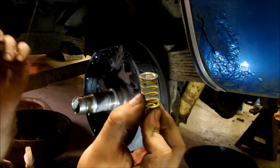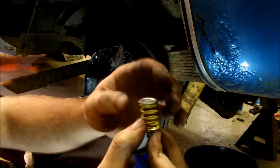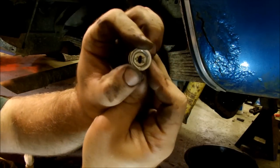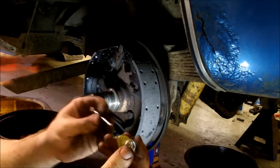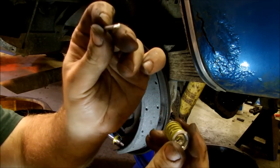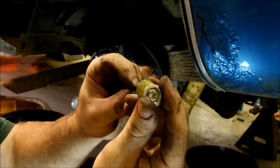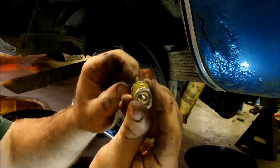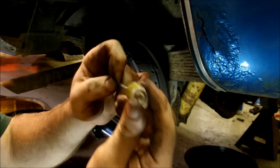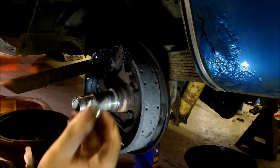And with that tool I described earlier, the hold down spring tool, you press in on this, you twist it, because up in there, see, there is a slot which will match the slot of the nail. And when you press down on it, it will go through, and then you want to twist it a quarter turn and come back out, and now it's trapped. It's going to make a lot more sense me showing you like this than it is on the actual brakes.